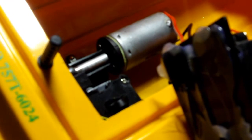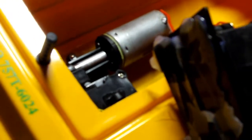To show you the size comparison — that is the motor we're going to be replacing it with. It's slightly shorter but a lot thinner, and obviously this one's water cooled as well. To get the screws out of the back of your motor you normally have to take your servo out. The servo is glued into a little plate — if you turn your boat over you'll find there are screws on the bottom. The four equal screws hold your jet drive in, and the fifth one, which has a little rubber grommet, holds your servo plate in. Take that screw off and the servo plate should just crack away from the boat.